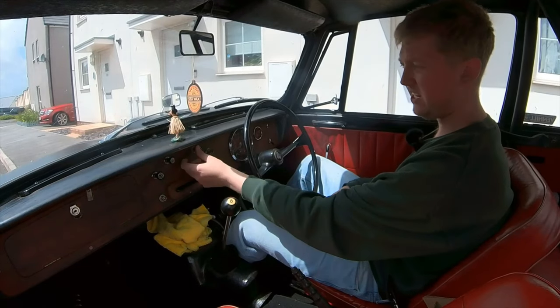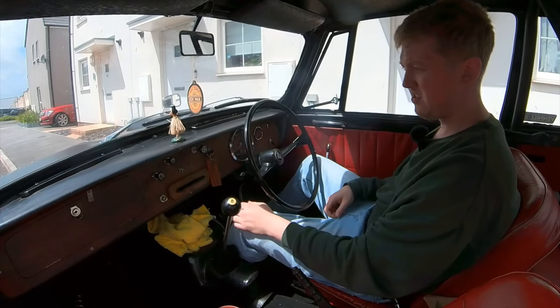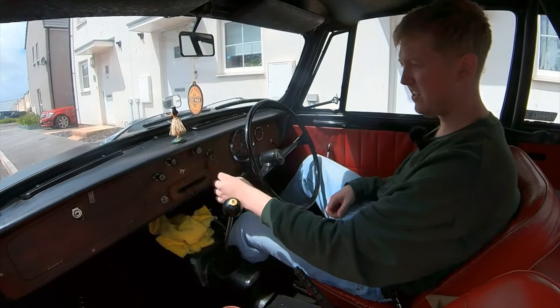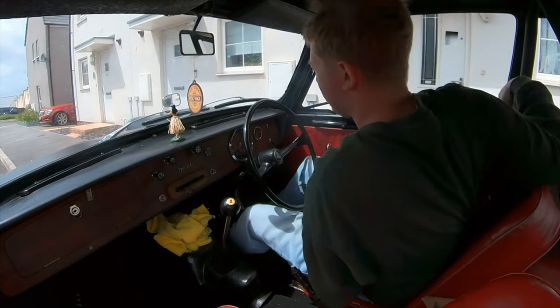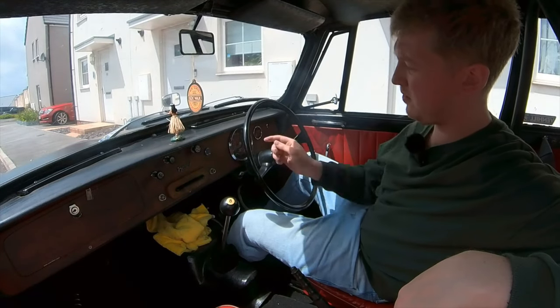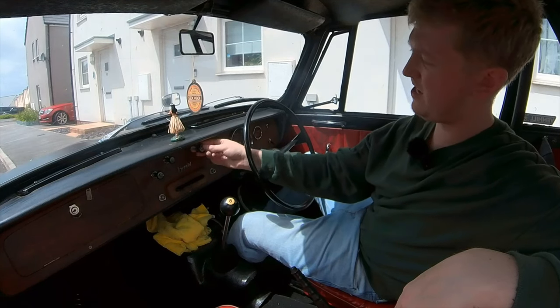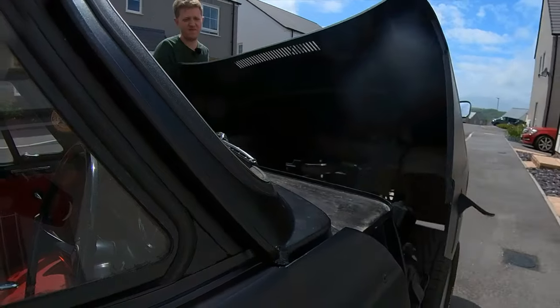The question is when we stop, is it enough to keep the engine going? That'll be the telltale sign. Nothing happens — nothing happens all that way. I reckon that's the issue. Pull the choke out there — you go. Interesting. Right, well, that's my first little test drive with the Triumph. I think it's a case of over-fueling because of that.